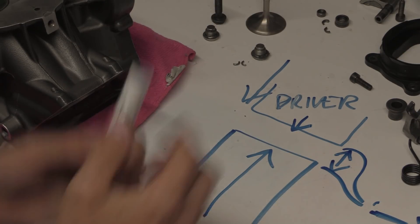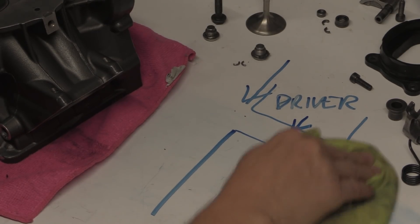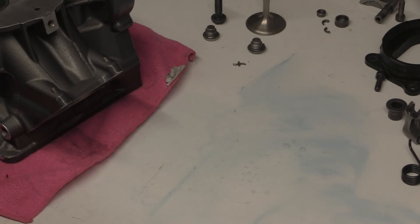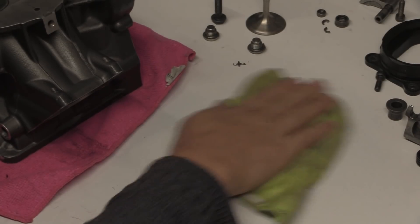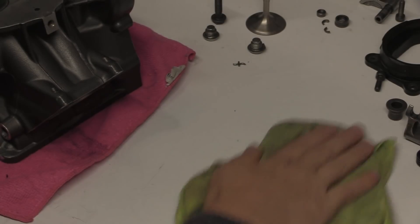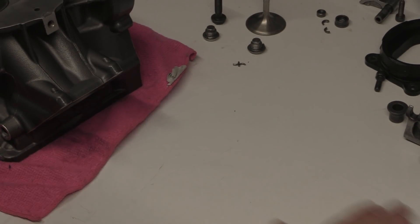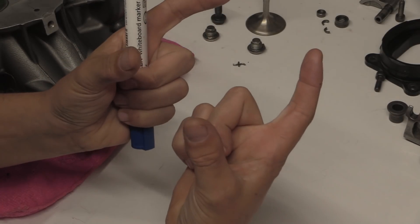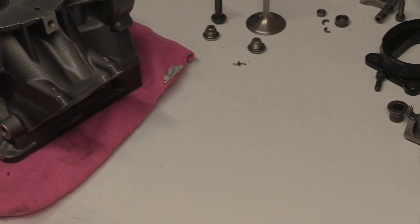The beautiful thing about springs is that they don't need this clearance. Springs, as long as they're pre-loaded — which basically means they're compressed slightly — are fine because any expansion is taken care of. A good example is the springs on your exhaust. Some exhausts have springs instead of mounting bolts into the head. Those springs are expansion springs, they're trying to contract and pulling. But if anything expands and pushes against them, they've got some wiggle room — fantastic.